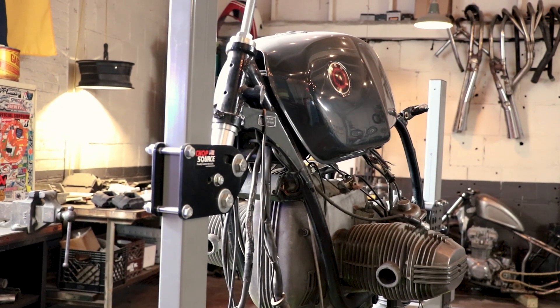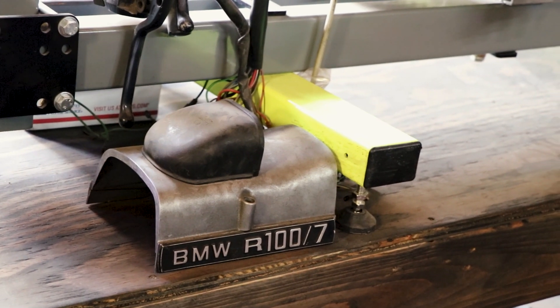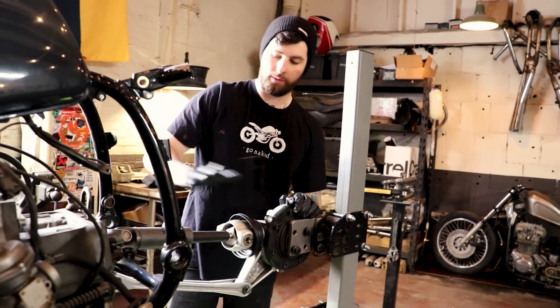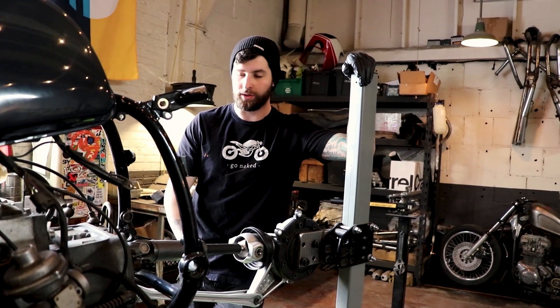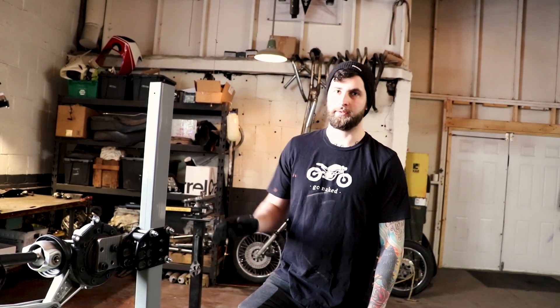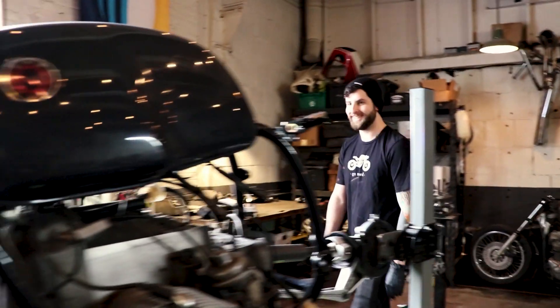The next one I have going on right now is a BMW R100. I got it when I was back in my garage — it's my friend Nate's bike, and I was working on both of these at the same time. I got into doing this back end and I wanted to make it a single-sided swing arm, so the wheel only bolts on from one side and it's totally open on the other side — there won't be any swing arm on this side. With help from Godfrey's Garage, I'm going to be building my own mono shock single-sided swing arm for this. It's really cool to go way out of my comfort zone and try things I've never done before. It takes a village.